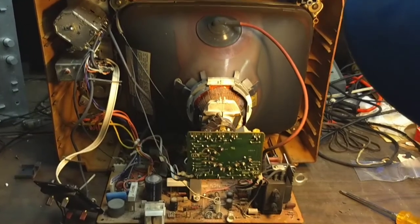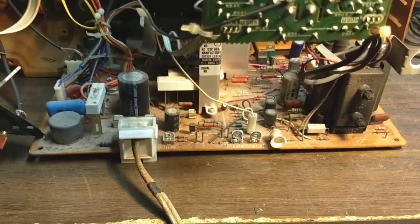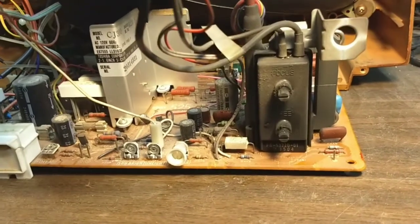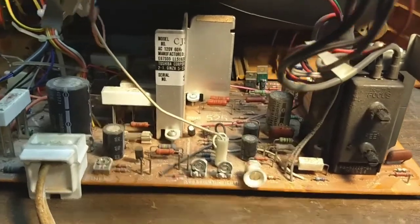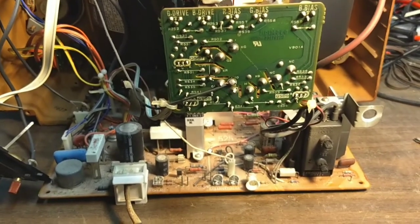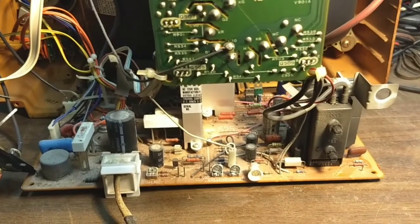With the back off, here's what we're looking at. You've got your CRT board here — the soldering still looks pretty good on the socket. You've got your monolithic board. This was definitely not an expensive set. You've got a self-contained flyback, no tripler. Big heat sink for your vertical and regulators. Up there are your tuner. The next thing to do is flip it up and see if we need to do any resoldering — that's pretty common on Toshibas of this vintage.